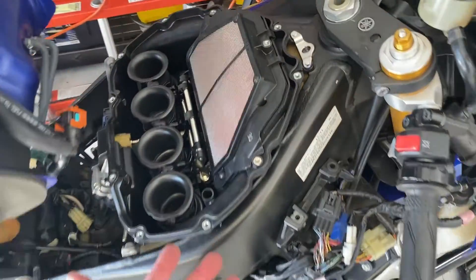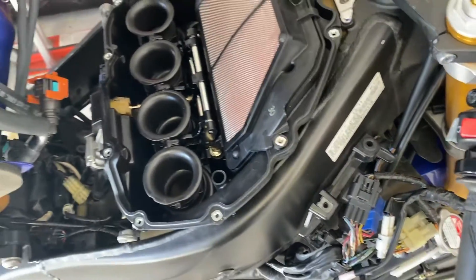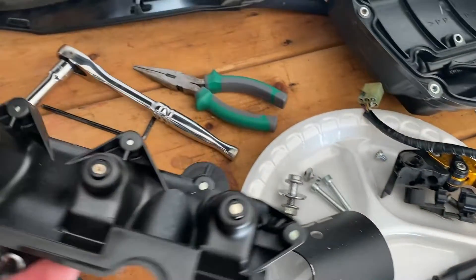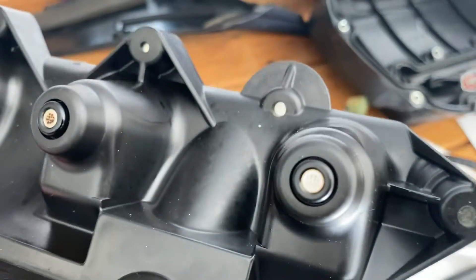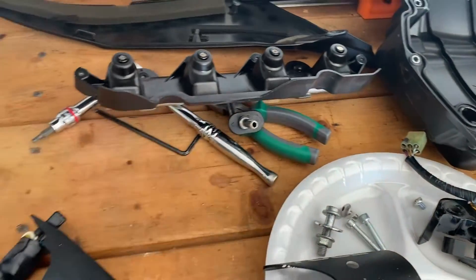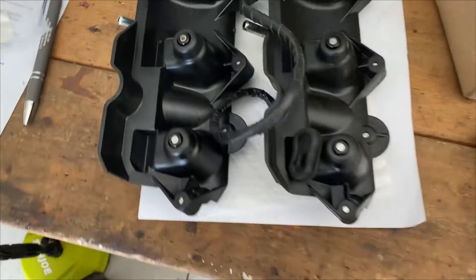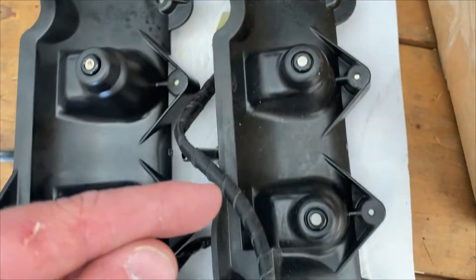We have reached a good checkpoint. I got the lower part of the airbox reinstalled and the air filter reinstalled — I might change this at some point, it looked a little dirty, but I blew it out with the air compressor so it should be good for now. You might recall on the last video that the secondary injector system is really filthy — you can see the corrosion and the rust on these injectors. One of these looks salvageable, but I did order a new secondary injector set. This may have been part of the reason the previous owner had some top-end fueling issues. Here is a side-by-side comparison of the old versus the new — I think we're going to have a much improved fuel delivery system.